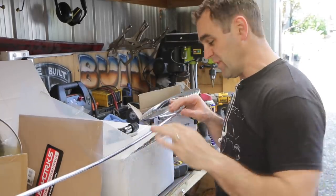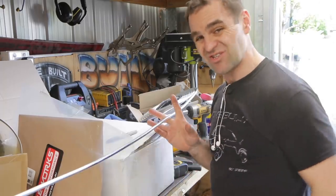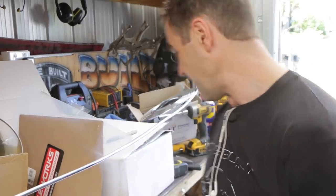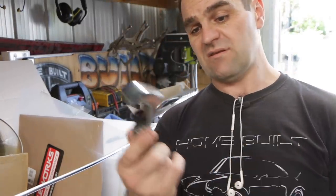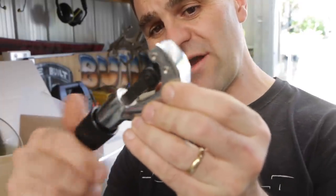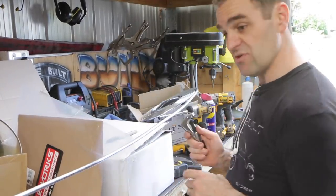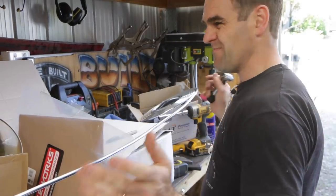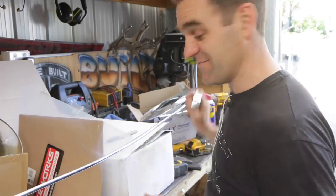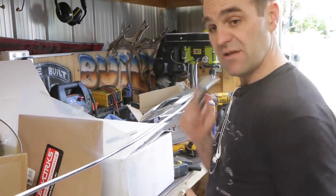This is not properly straight yet but it's very soft aluminium line so I need to be careful. You can't just cut it because you're going to crimp it or get burrs. The best way is with a tube cutter — this one's from Raceworks, the same thing plumbers use. It's got a little wheel blade; you just tighten it up on the rollers and keep rolling around, tighten, roll around, and it cuts the pipe cleanly. I'm going to do two two-meter lengths — that's probably two to three hundred mil more than I need, but it's better to have more than not enough.